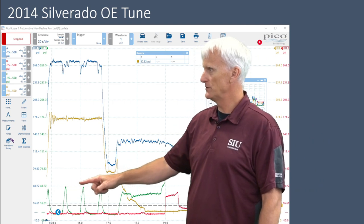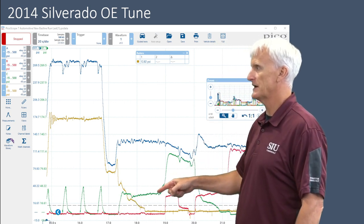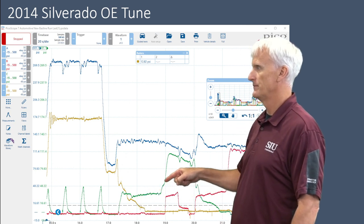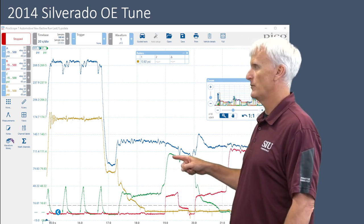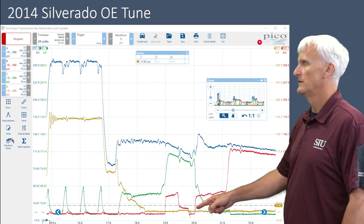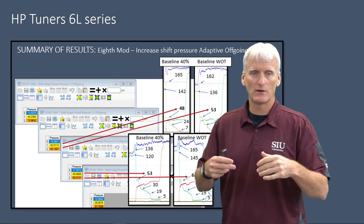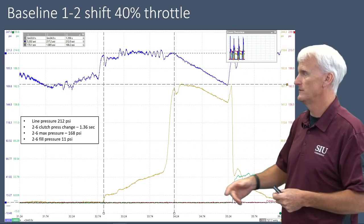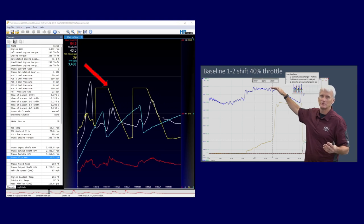Here's that same image zoomed in. You can see the pulses that occur just before applying the 3-5-R clutch — this is the shift from second to third, where second gear is releasing and third gear is applying. Looking at it in terms of phases: that's the fill and torque phase, then the inertia phase, then the clutch holding phase. Check out the next video in this series, which covers the baseline observations — the normal operation of this vehicle before we did any modifications, looking at pressure curves and normal behavior that we'll be comparing against our tuning changes.